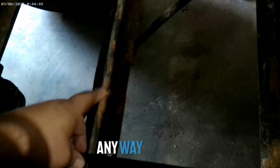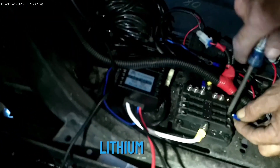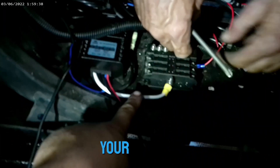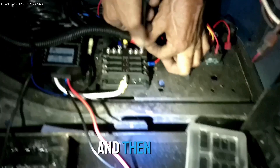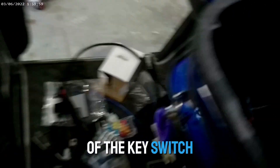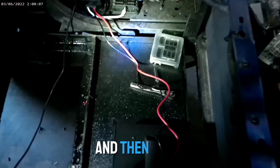Just do one on each side, and then with those cut off, you won't hit the battery. If you don't have any way to cut these, you can also just hammer them down — typically just fold them over with a hammer. So right now we're wiring up the accessories. We've got the lithium Rhino DC converter in there, and we're adding a fuse block. The black and the white off the converter — your white is your positive to the fuse block, your black is the negative. Then you have a black and a red — these are going to be our power wires. We've got to extend these; they're going to come over to the battery. And then your blue wire is a key switch wire, so you're going to have to run a wire off of that one up to the key switch, on the non-hot side of the key switch so it turns like a burner on and off.